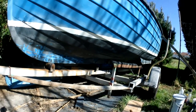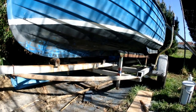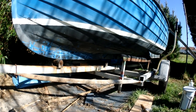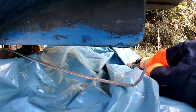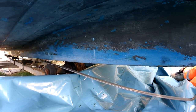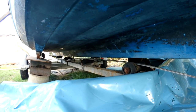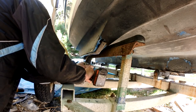The gel coat on the fiberglass is done and I've just sealed the screw holes up, so now we've got to wait another 24 hours at least before we do any more — might be today, tomorrow, or the next day we'll put the keel band on. The keel has been prepped, repaired, and we're now putting the keel band on. We've shaped it to fit, and we're going to put sealant along the bottom, screw it all the way up, then drop the back on the trailer and do the front.